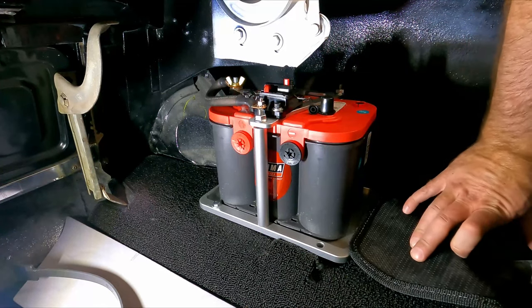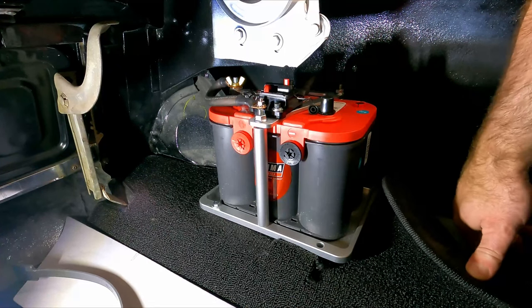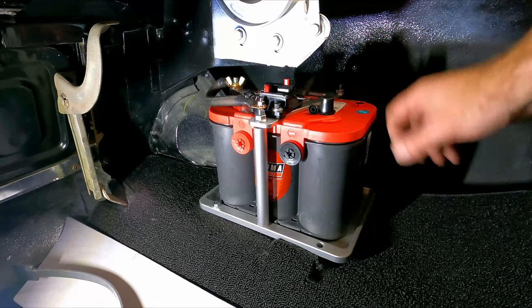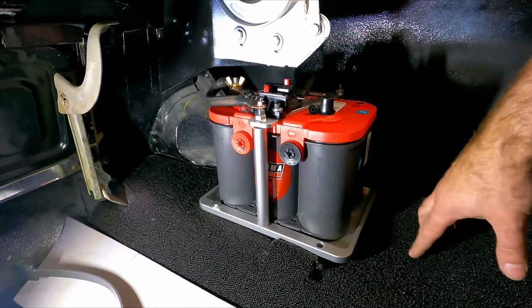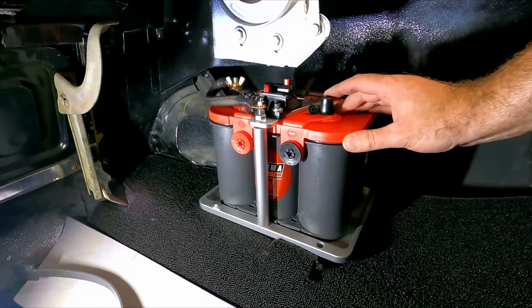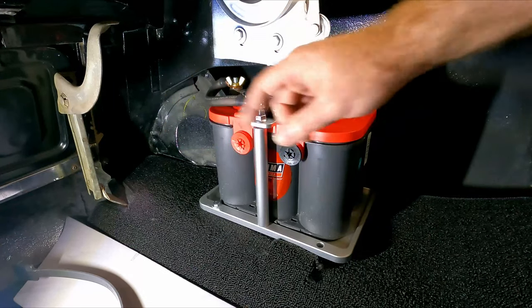And there's a bolt down here that actually holds the bumper on, and it's a pretty good frame bolt down here, so I'm going to ground it to that, nice and short distance, but we'll do that at the end. We'll cut that off the other end of the wire when we fish it all the way up to the front. So from here, I'm going to jack the car up and start routing the wire underneath the car, following the frame all the way to the front.